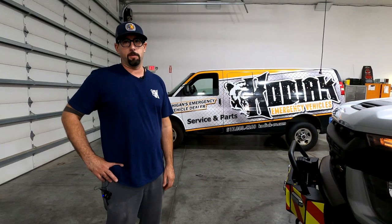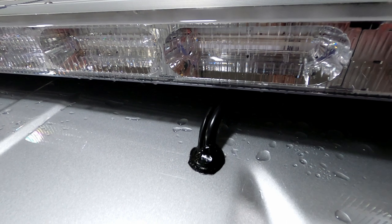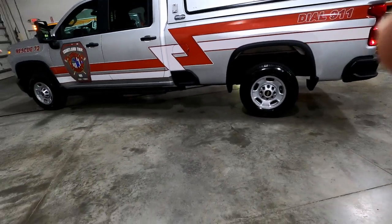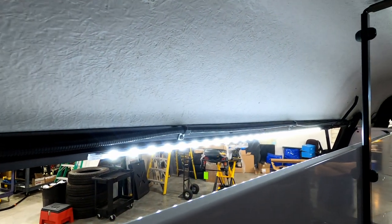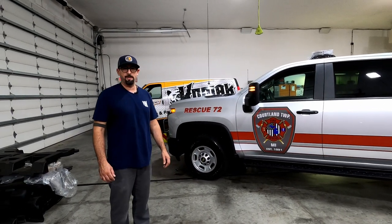Every single drill or tap has ECK on it — ECK is a dissimilar metal compound used to help with corrosion. Each individual hole is reamed and also protected from rust. So if I drill a hole in this vehicle, there's virtually no chance that it's going to be a source of rust in the future. This thing goes down the road and it's going through five Michigan winters, and when it looks exactly the same after five Michigan winters — no bubbling behind the lights, no weird stuff with the wiring or general mounting — that's the difference. It lasts the life of the truck. Hope you enjoyed the walk around. The customer's on their way and we're very excited to deliver.